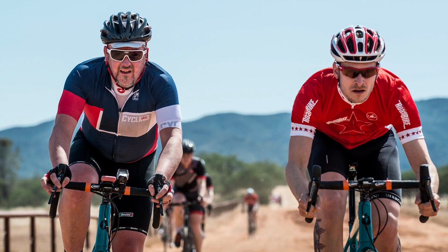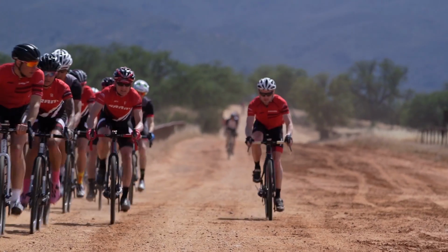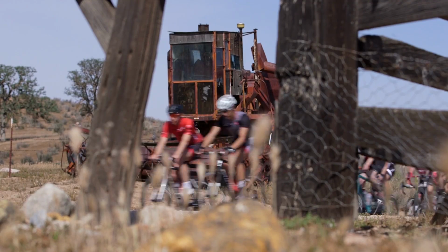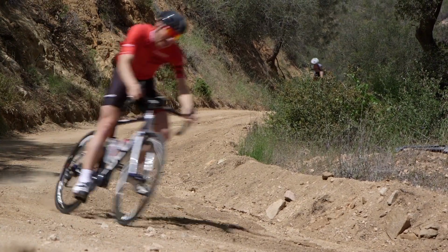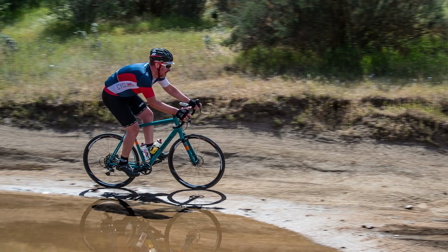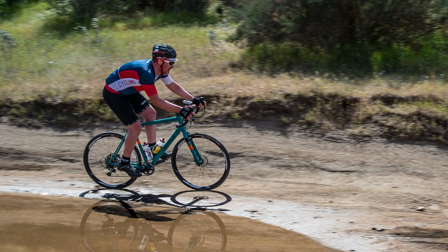With my experience of trying the new systems with the much wider ratios, recently coming back from riding it on gravel roads in California and using a super wide 10-42 on the back with a 44 chainring on the front, it gave me a lower bottom end than you would get from a 50-34 with an 11-28 on it, and at the top end it was within 2 or 3 inches. So you had everything you needed. That central section of gearing, which you use 90% of the time, the steps are absolutely fine. It's only when you get to the extremes of each end of the cassette that you've got the bigger jumps. But when you're riding on gravel, you're not actually doing that kind of smooth cadence rolling all the way up and down the gears.